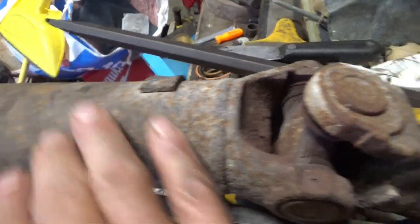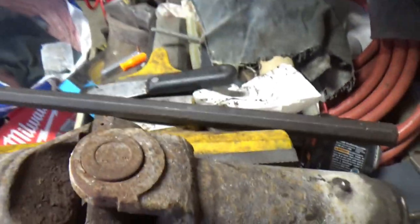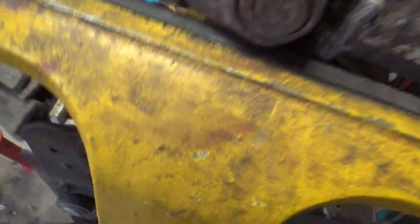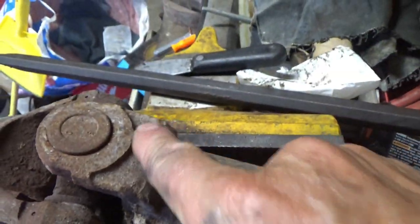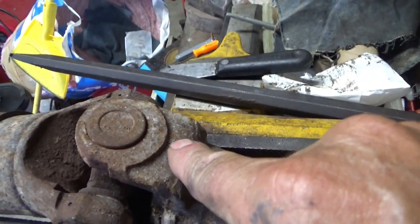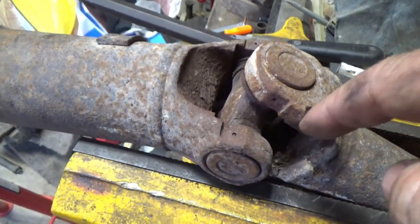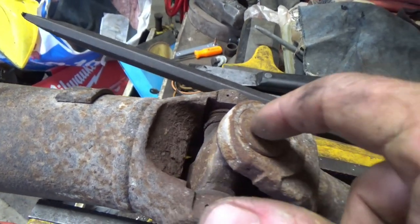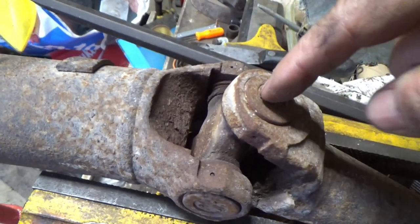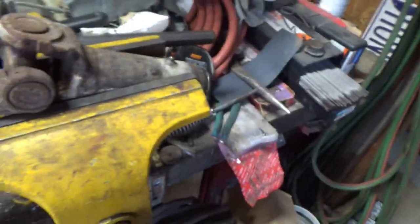Because we can support this driveshaft, we cannot support this little tiny yoke by itself, so we're going to knock that off. What I'm going to do is, while this is sitting in this position, I'm going to hit this part with a hammer — smack it hard, real hard — and it's going to knock this down and the u-joint in here is going to push this cap right out the top. Let's get the camera set up on the tripod for that.